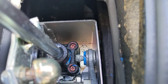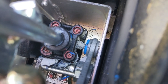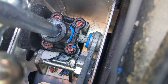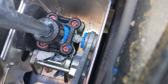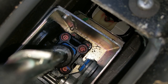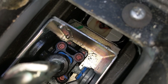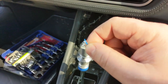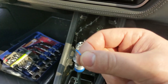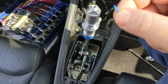Once I move it a lot, then it moves. So there's a lot of black shavings down in here and I don't like that — there's no reason there should be any shavings there. There are also blue shavings down there, which is not good. The gearshift has clearly been struggling.